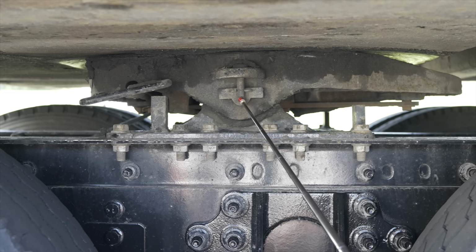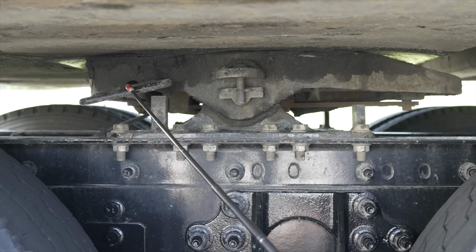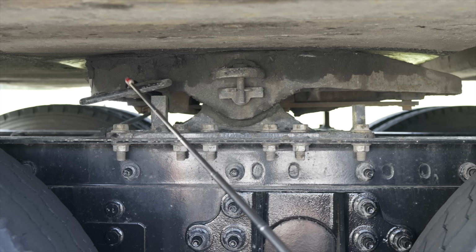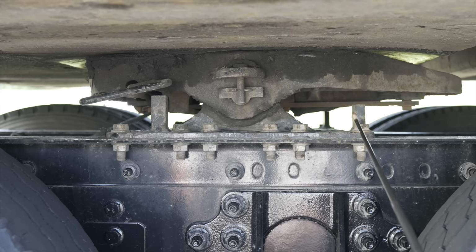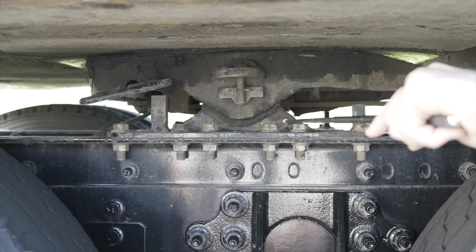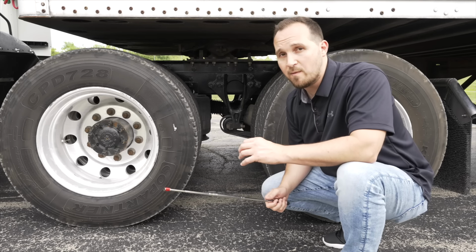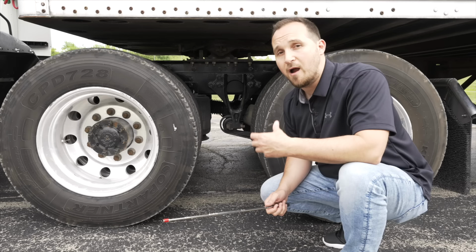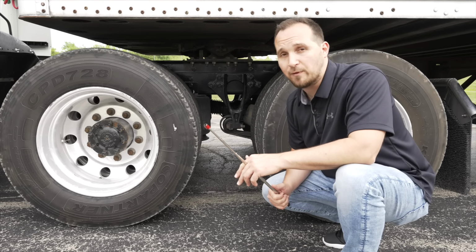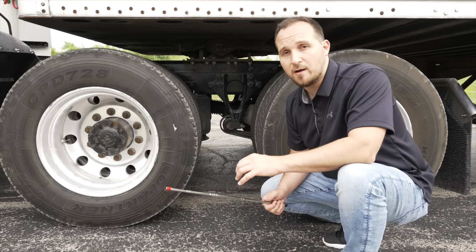Our release arm, it's in lock position. It's not broken, not cracked, on secure. You want to make sure that it works properly. Our mounting bolts on our platform, they're not broken, not cracked, on secure, all on tight. The platform, it's not broken, not cracked, on secure. This is not a sliding fifth wheel. If you had a sliding fifth wheel, you want to make sure that the locking pins are on tight and locked properly. Now we're going to go to the back end of the tractor to check for our locking jaws